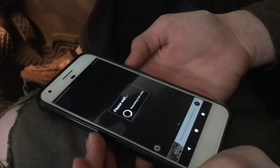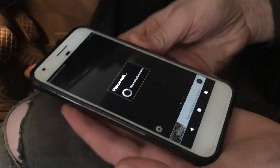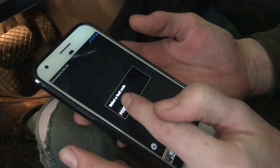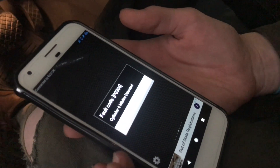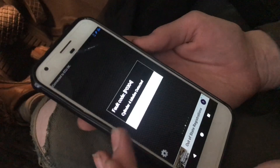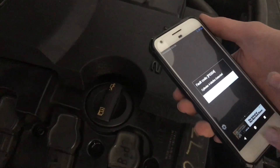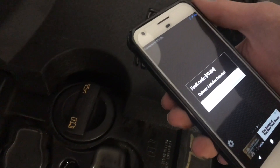It'll request the fault codes from the ECU. We have a Bluetooth adapter that goes into the OBD2 port and sends a Bluetooth signal back to the phone. Now if we take a look at the phone here, it says fault code P0304. If we click on that, it tells us that's a cylinder 4 misfire — so this is isolated to just one cylinder.